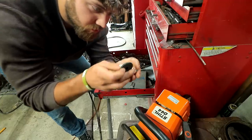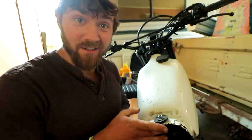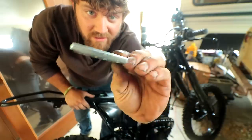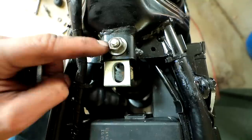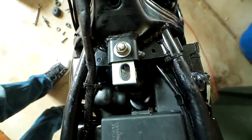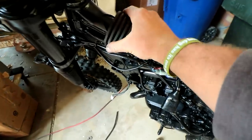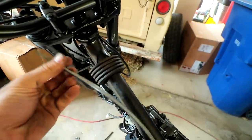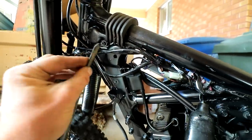Washers, rubber washers, nuts, lock washers — before I go ahead and just make a custom bracket, I want to see if I could use the existing one and just throw some hardware together. I found several of these little brackets sitting around, trimmed one edge off, mounted it up to the existing bracket, and now I have a mounting hole that's a little bit farther back. For the front of the gas tank, this is the original mount bushing rubber piece that came with it — I'm just gonna zip tie it on. There's two holes on the sides and we'll test her out.